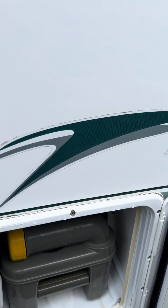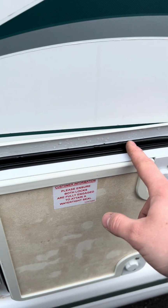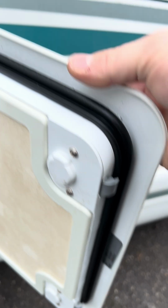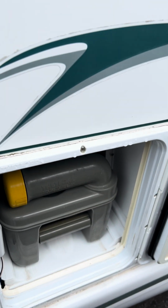It doesn't have to be every time or anything, but just whenever you get a second to do it. Same sort of thing with these rubber seals. It looks like we've done it as part of the hab check anyway. But if you can spray silicone lubricant on any of these rubber seals around the doors, it will stop any water coming down and into the locker.